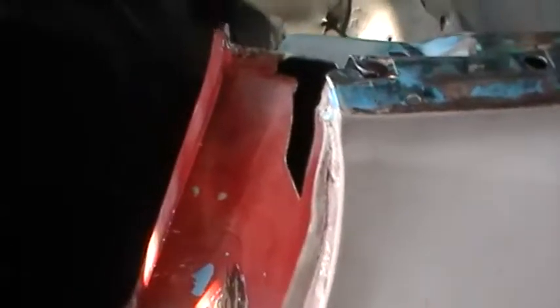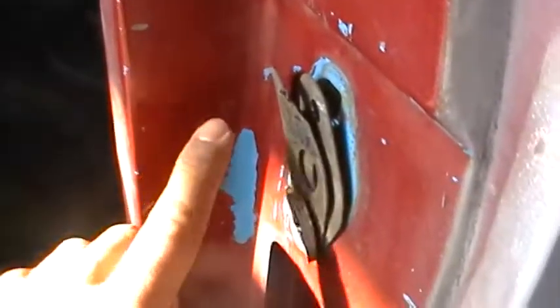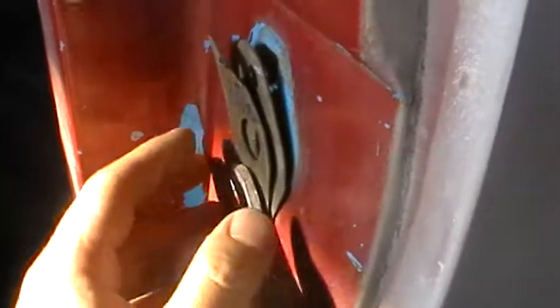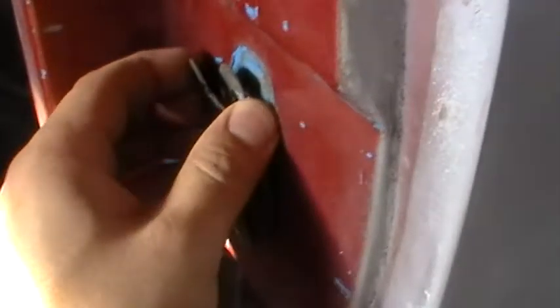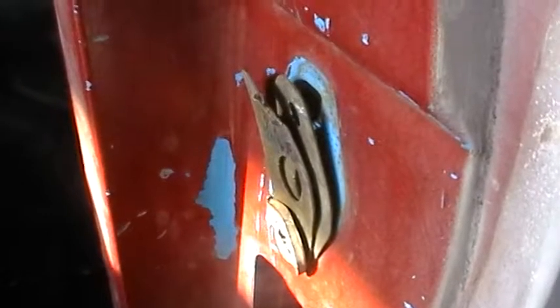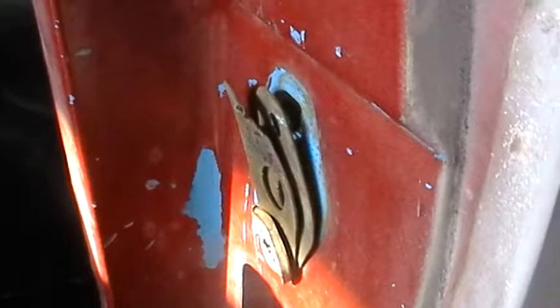And that's because at some point — I think when they painted it — they painted over the original grabber blue with the red, and when they painted it, they moved them. So I couldn't get these off. I couldn't get the door striker off, even with an impact wrench. I was hammering on it. The screws must have had Loctite or something on there.